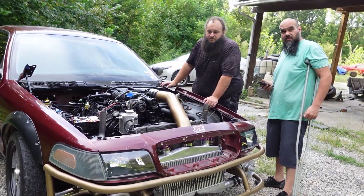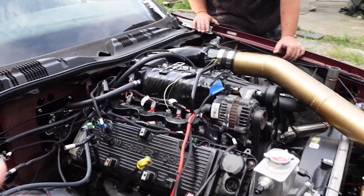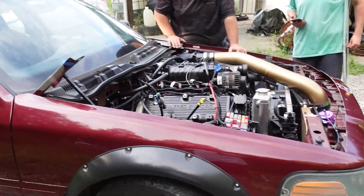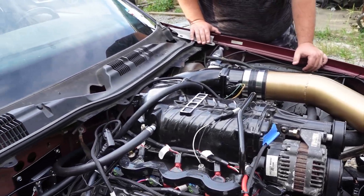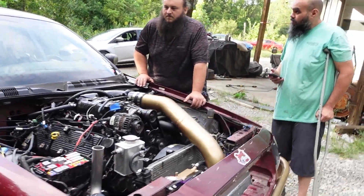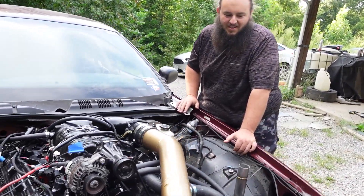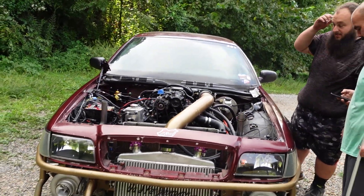It's still a success, I'd say — technically. We're going to have to go back through it, maybe change some plugs since we did have to tune up a little fat on startup with cranking fuel. Check some things out, get this thing back out and see what it's going to do. Hopefully it's not making 15 pounds of boost at 2900 RPM — but I'll check the log over. We've got to fix the scavenge pump. If you like this video, give us a thumbs up and subscribe if you want to see more. Until next time, peace.